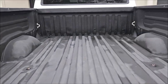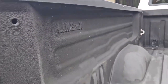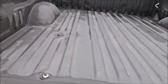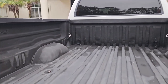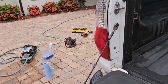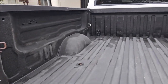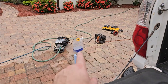I still need to wipe it down with wax and grease remover to remove anything that's on this Linex — this looks to be an earlier install. I already scuffed the ever-loving piss out of it and used my Tiger's Blood, a discontinued heavy-duty industrial degreaser from detailjuice.com. I sprayed it all down with a heavy dilution and scrubbed it really well with a hard bristle brush, then pressure washed it out.